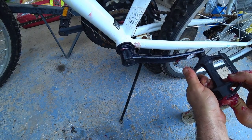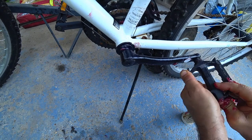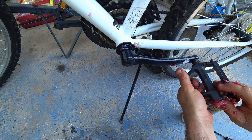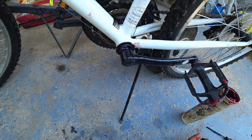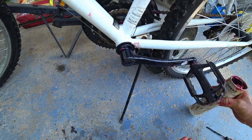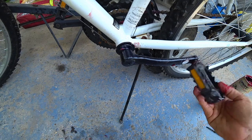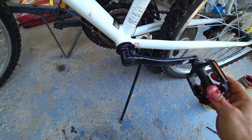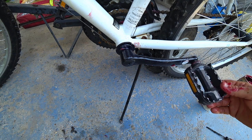This isn't as easy as the hubs with the grease fittings, but there we go — grease is coming out on the other side now. You just stick the cap back on, and once that grease gets worked in there it will reduce the friction in the pedal bearings. When you get the friction and drag out of everything you can on the moving parts, the more you ride it the more it'll free up. Do the other pedal on the other side the same way.